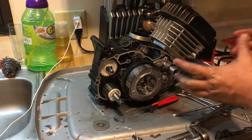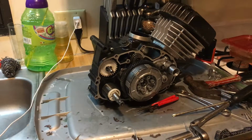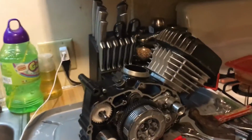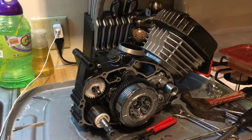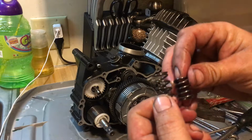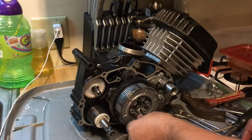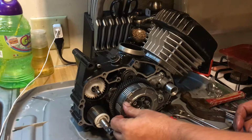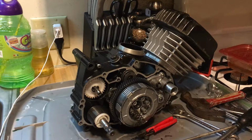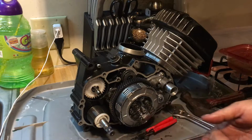I was going to compress it, make it like a clutch pack with 2 flat washers and a nut and bolt. But then I remembered how I did it last time. I'm just tired. Last time I used longer bolts on the clutch spring because these aftermarket springs, I'll show you the difference, are almost a half inch taller than the factory ones. Okay, so this clutch is going to grab like crazy, which is exactly what we're looking for, what we want to have happen.